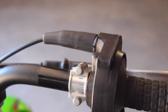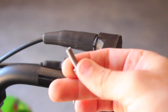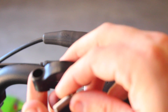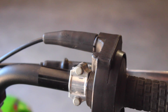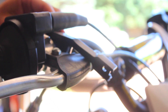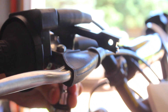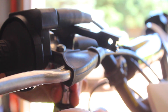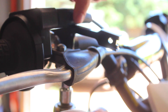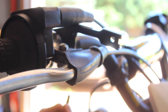I'm going to be installing the right side first. With the mounting brackets, you basically just take your set screws — you get four of these guys — and then they each go into each hole down here. Once you've got the set screws started, just kind of adjust the height of where you want your hand guard to sit. It kind of rests against the bottom of the throttle cable, so you only got so much movement on this side at least.